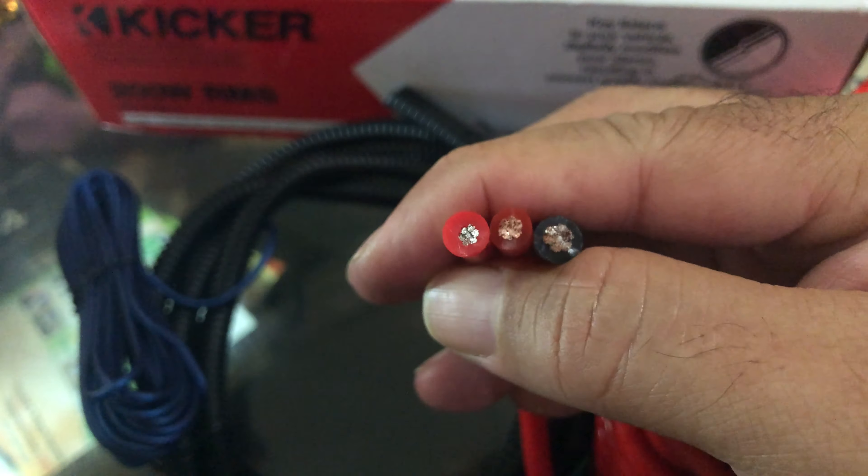It does make a difference in the amount of power. If your device needs the power — because the JL Audio sub recommended 8-gauge — it works fine with the real 8-gauge. If I put this CCA stuff in, it's going to put out a lot more heat than it should, because this real cable doesn't even get warm, it stays cold. The CCA one you can actually feel heating up — it gets really hot. So just to give you guys a warning: don't use anything copper-coated aluminum. Make sure you have something to compare it to.